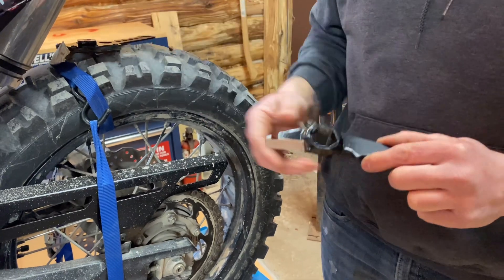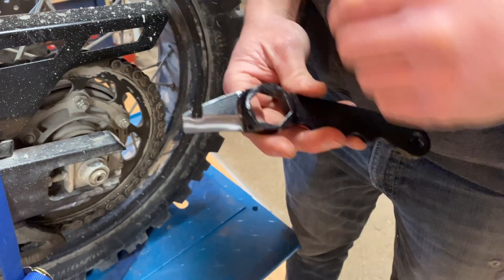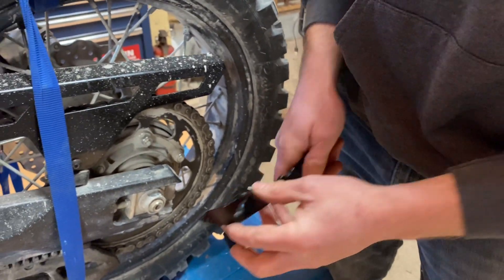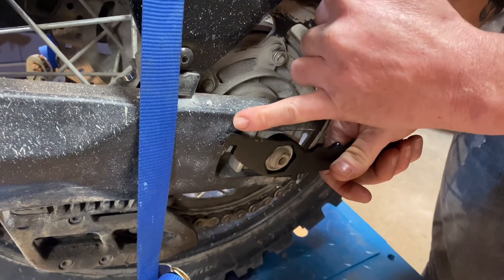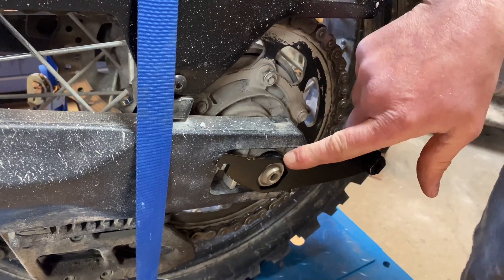On the knife you've got a large socket for the rear axle, and you'll see one side sticks out proud from the knife handle itself — that's to allow you to get to full depth on the nut while still making clearance on the swing arm. Now obviously this won't provide enough leverage to remove this axle nut on its own.